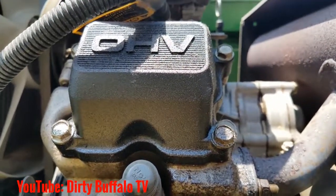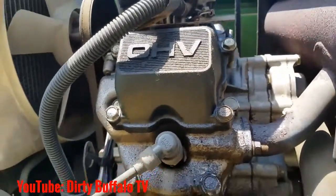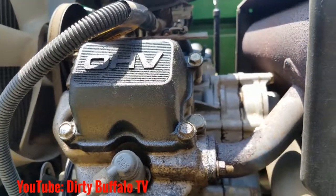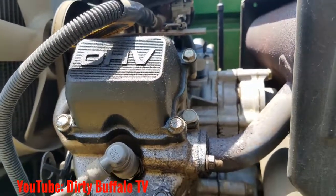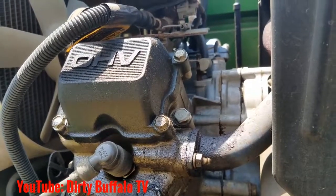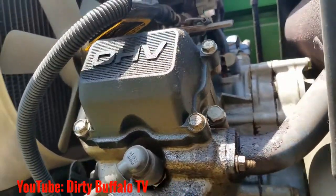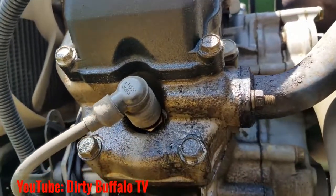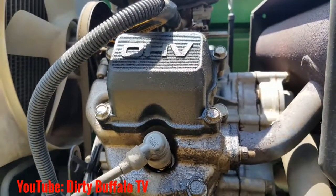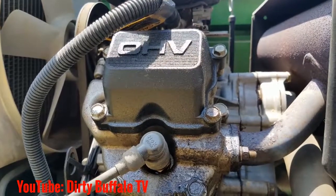The best thing to do here is replace that valve cover because it's not going to have a very good sealing surface left on it, and put a gasket in there instead of the o-ring to seal up for a good long time. This doesn't happen just on John Deere engines — Kawasaki has these engines in other brands such as Kubota and Cub Cadet, just to name a few. So if you've got this problem where you put a new o-ring in and it still keeps leaking after a week, two, or a couple months — now you know how to fix it. Replace the valve cover, put a gasket in instead of the o-ring, and you'll be good to go.